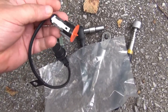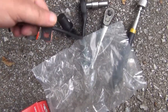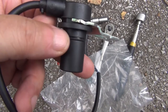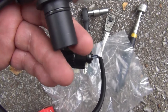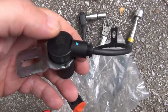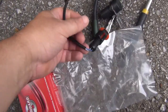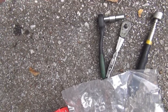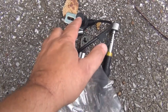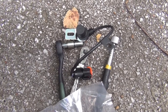This is the pigtail that it plugs in at. This middle section just plugs in, and this is the sensor right here. You push this down in the hole and it snaps in — it's got an o-ring in it that holds it there. This is where the 8mm bolt goes; it's got a casing over it. This part right here is closer to the transmission dipstick. The pigtail snaps in and this just goes up under the casing. It shouldn't take more than about 10 minutes.